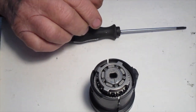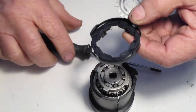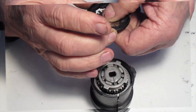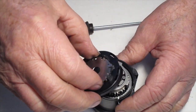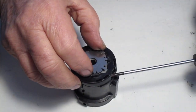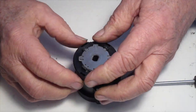We're going to insert the end plate into the cap. It has eight tabs on it; four of the tabs fit into the slots in the cap. Push it all the way to the front. Turn it over and assemble it so that the grooves line up with the bottom of the transmission, and it also indexes with the outer race. Snap it into place.